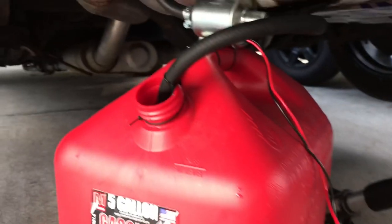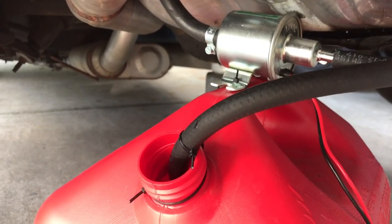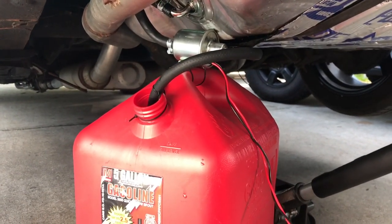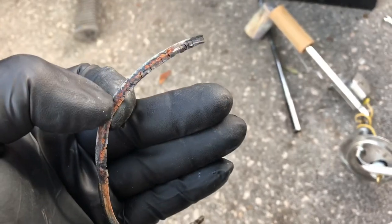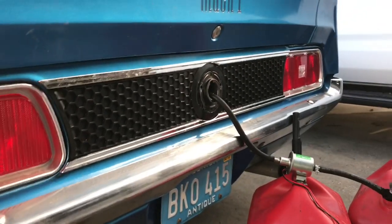You can make little leads or just hold them on there — up to you. I don't have a lot of gas in here so I didn't need to go through the whole hassle, but that's how you do it safely guys — just pump it all out with an electric pump. All right, there's the old sending unit out. Here's the old sending unit seal — it was broken right in half, cracked everywhere. Look at that — it's all cracked and screwed up.